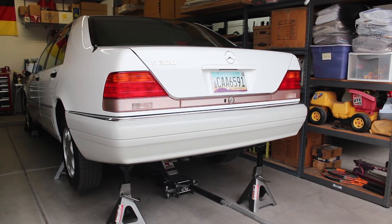This is the W140 body style. A couple weeks ago I replaced the fuel filter and when I did, I found the lines were original from 1995. One of them was so rotted it was leaking a lot of fuel, so I replaced it. Then when I went to start the car up a couple days ago I noticed there was still a leak, so it's either the same spot or a different area because all the lines are rotted.